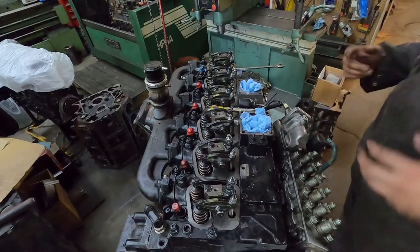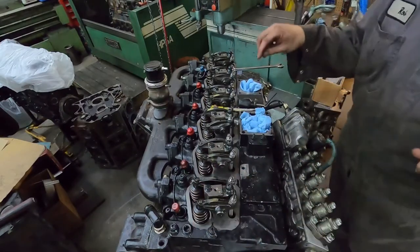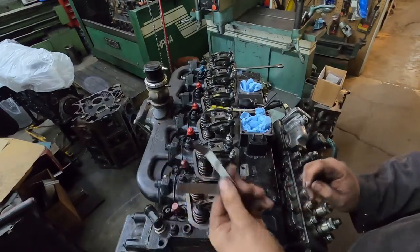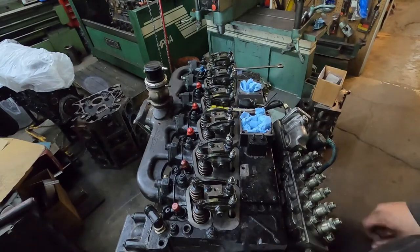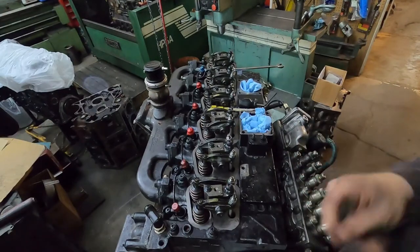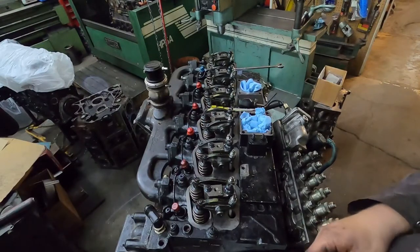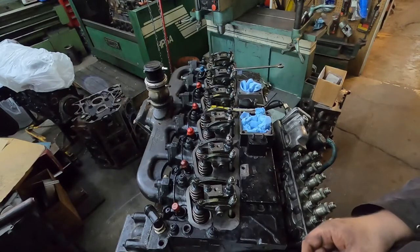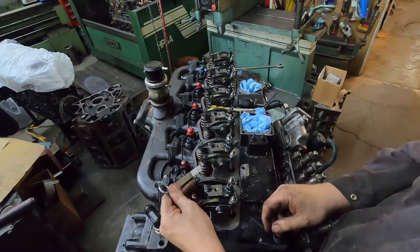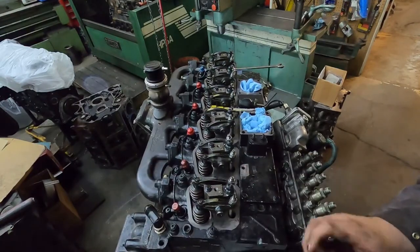It's easy to pin them, and if you've never done it before, you know it's top dead center. So to start with: on a 12-valve or early common rail, or any of the common rails that are deleted, it's going to be 10 and 20 thou. The emissions trucks — I want to say it's 12 and 26 — but it'll actually say right on the valve cover. You can just put the feeler gauge underneath there and you want a little tiny bit of drag, but not a lot. These ones are relatively dry so they do have a bit of drag.